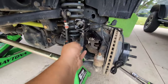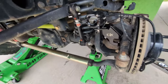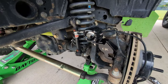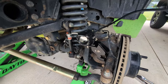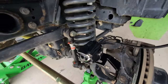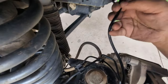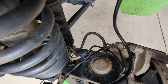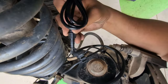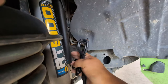That's just a 13-millimeter nut that goes on these — it's going to vary depending on your light. These will have to be tightened up once I get the tire on so I can aim them. Your wiring needs to follow along the ABS line — I'll double check that to make sure. In essence, we're going to go through here, loop into this, follow it up, and literally just follow the ABS line all the way up and come right up to the engine bay.